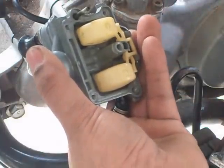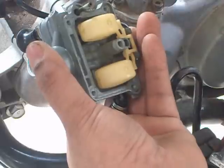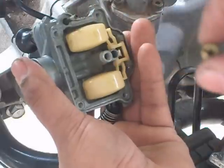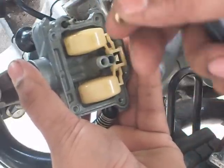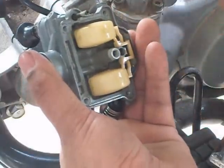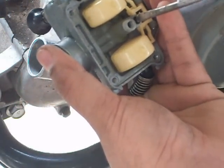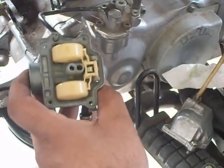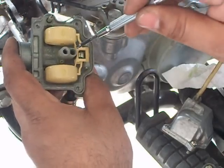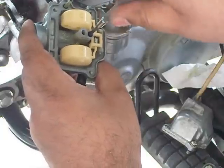Yeah, it's clogged. Yeah, that'll cause it. It wasn't too bad, but as you can see, it's just a little bitty old thing there. So get that cleared off, and you have another one, which, okay. Alright, found a little screw I needed. That was the main. This is the idle jet, so I'm just gonna take this out.